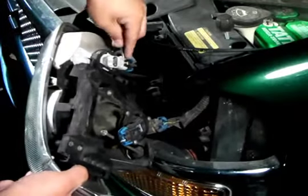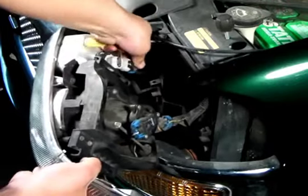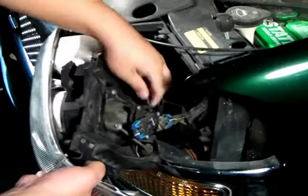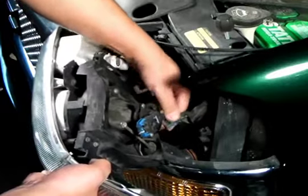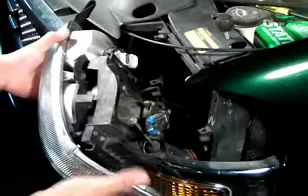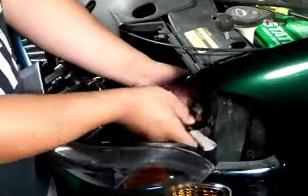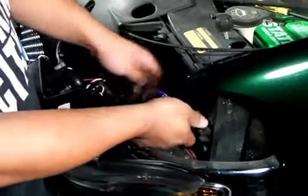Please pull the headlights out just enough so that we can remove the headlight bulb harnesses. Once the headlights are free, bring over your projector headlights so we can replug the harnesses and put them back into place.